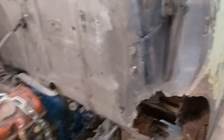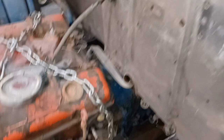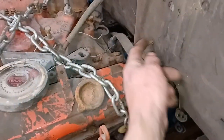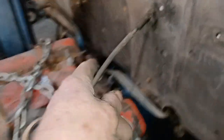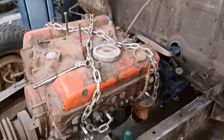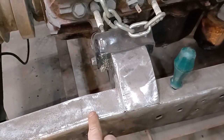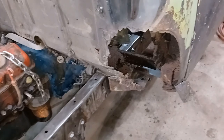Also, this cab's still got to come forward about an inch and a half yet, so it's going to be really close here. I'm thinking right now the whole cab is too far that way - it's got to come this way. We're probably going to have to notch this out a little bit and kind of build it into this factory dimple here. That factory dimple makes all kinds of room for my distributor, which of course goes in right there. Overall, not bad. I really couldn't have brought the engine much more forward than I did - if I moved it too much this way I might have ended up interfering with my Mustang II crossmember, and I definitely don't want to do that. So I think we're gold. Overall I'm happy.